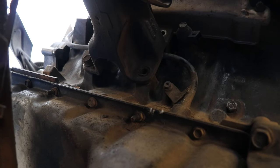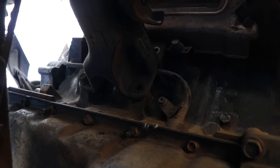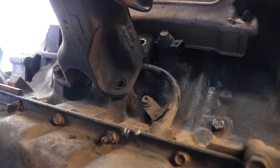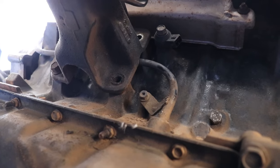We took out the two rear engine mount bolts. What we're going to do is get the hoist hooked up, take the weight off of it, and then remove the front two. Everything's loose, and then the cross bolt — we'll get that out. Basically you need to remove the engine mounts sort of after you've got the engine lifted, because it doesn't come out otherwise — there's not enough room to clear and it hits everything. Just FYI.